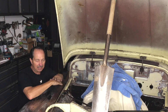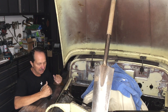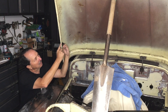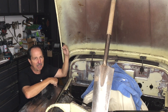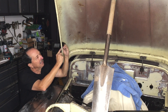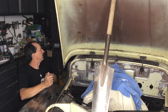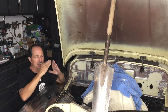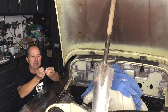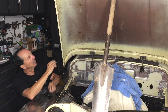This hood sits almost flat on the hook and I don't want it rattling and chipping or scratching the paint when it's all the way shut. At the same time, if I put screws up through a bracket here those screws will catch the paint, so I don't want that. There are other options - I can indent and bevel it and use a machine screw with a flat head, beveling the bracket the same way so the screws are nicely dimpled in.